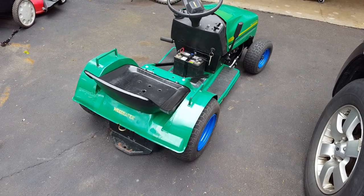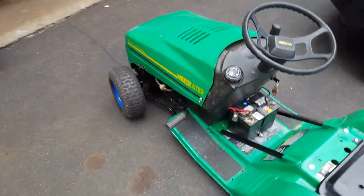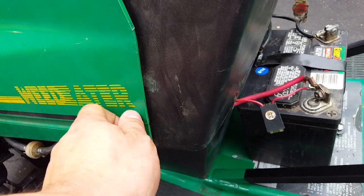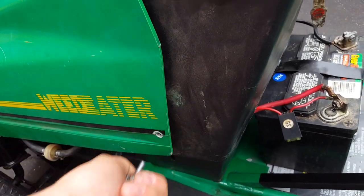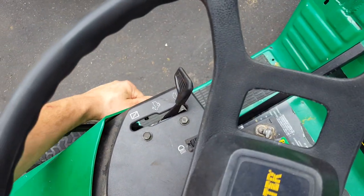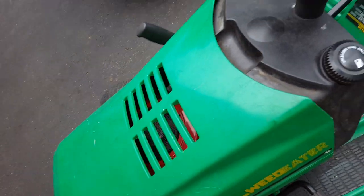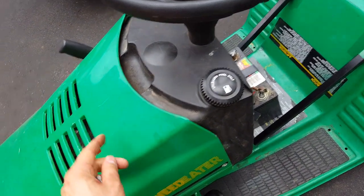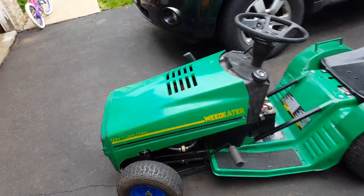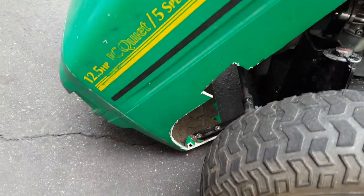So eight inches lowered, and all the pulling mechanism stays the same. I used my favorite tool again — rivnuts on both sides — so the hood doesn't rattle and doesn't come off, because I trimmed so much off of it. You'll also notice it doesn't come up all the way — the end of the hood is supposed to sit a little higher — but you get that low look. That's as much as it opens, and I had to trim a lot of the fenders and hood for tire clearance.